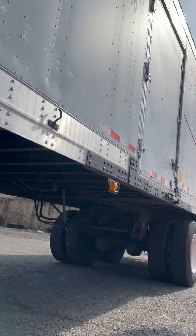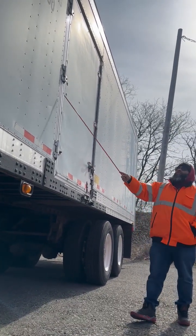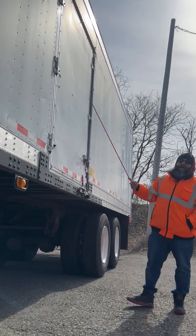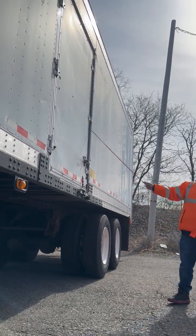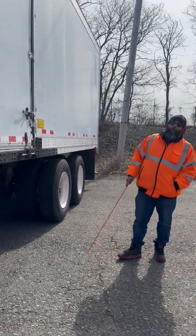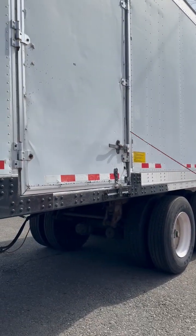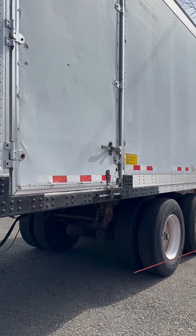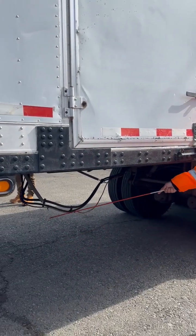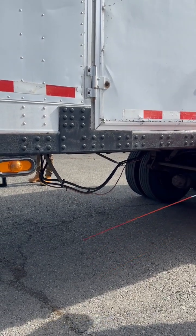My trailer side door, properly mounted, not cracked, broken, or damaged. Has all of its nuts and bolts. My door seal, properly mounted, not cracked, broken, or damaged. There are no signs of leaking. My side door latch, properly mounted, not cracked, broken, or damaged. It's in the locked position. My air hoses and electrical line, properly mounted, not cracked, broken, or damaged, not leaking, no signs of corrosion.